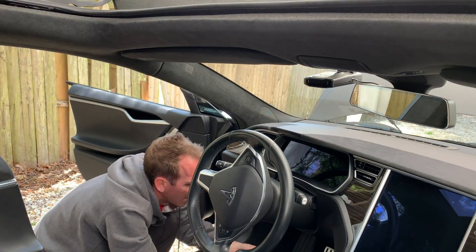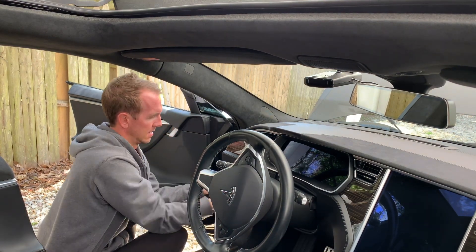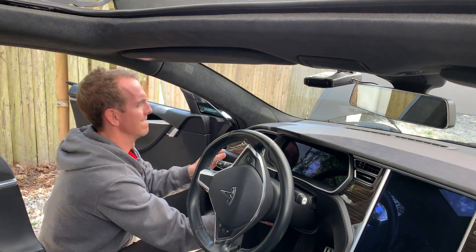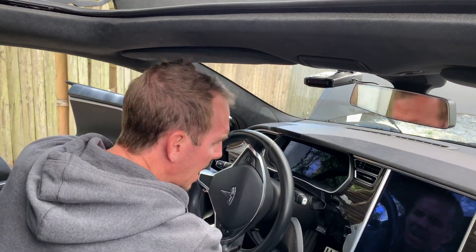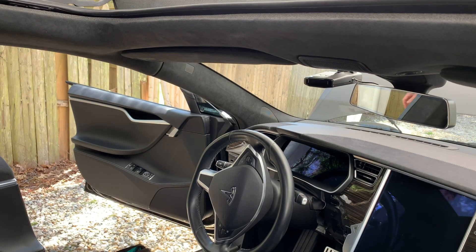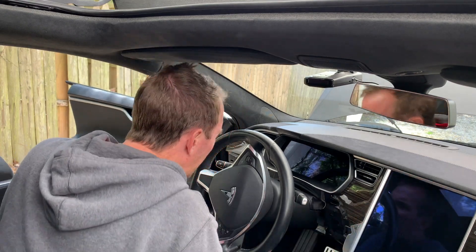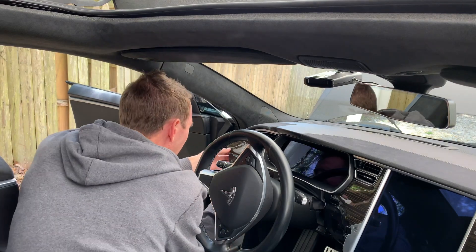Now we've gone to the inside of the car. This is going to go pretty quick because I've done this quite a few times. I just removed one T15 bolt — that's the only thing that holds the lower knee kick pad in place. There's another little piece I just took off; that's the inside of the door trim, just a little plastic cover held in by tabs, so just pressure and it pulls right off. The knee kick plate you can just pull right off. Now I'm going to go around and get all the T15 bolts. That one was for the air vent housing and then there are two on the left air vent housing.